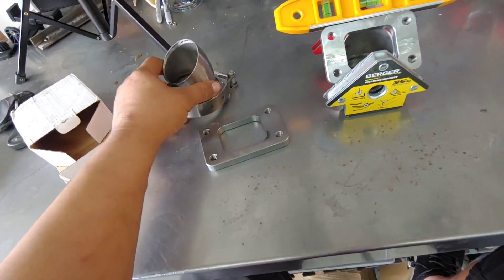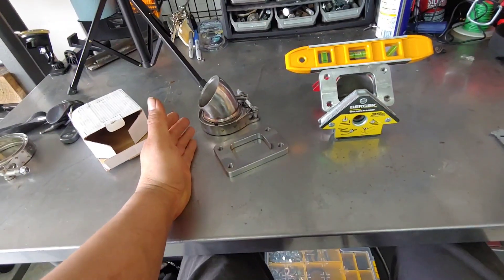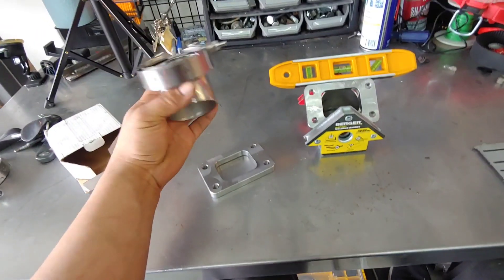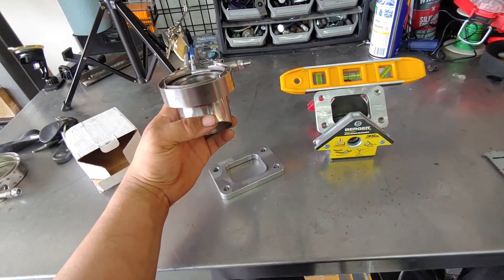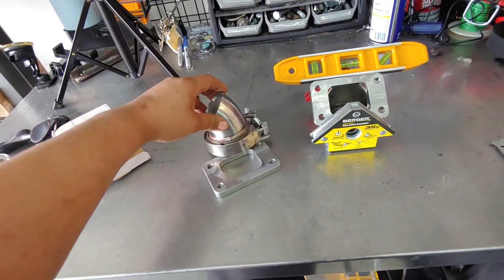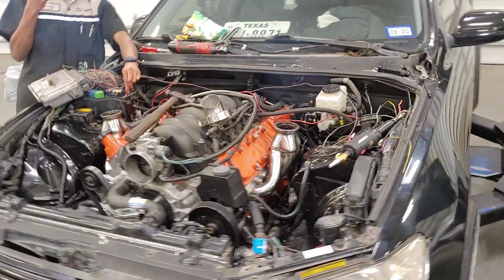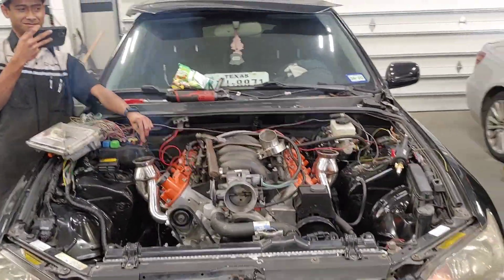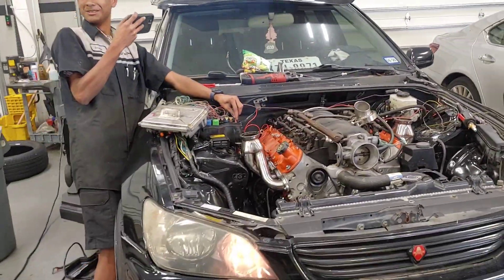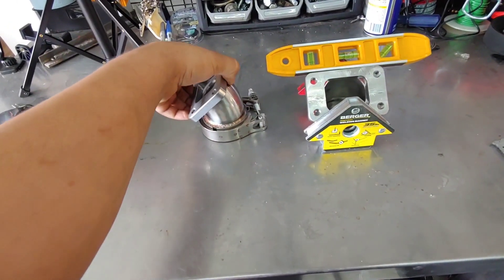I'm here at Trailblazer Film Studio. I'm welding these little V-bands. They were originally turndowns because I ordered a set of shorty headers and they have a V-band flange, and they're designed to be a turndown so that you can connect to your exhaust system underneath the car. But since I flipped the headers upside down, they're pretty much going to be perfect for the twin turbo setup I'm running on the IS. It's going to be upside down like that, directly on the header, and then a T3 flange can be just like that.